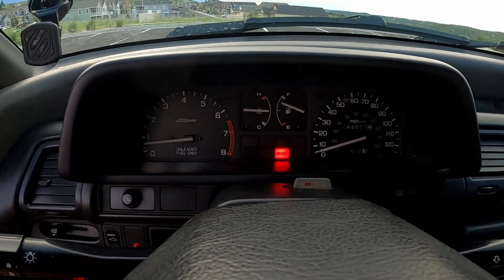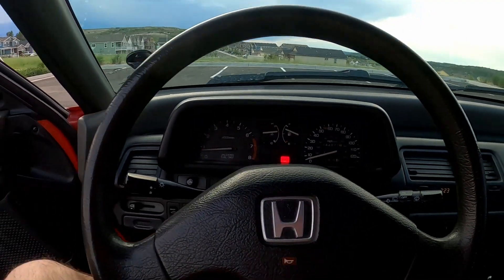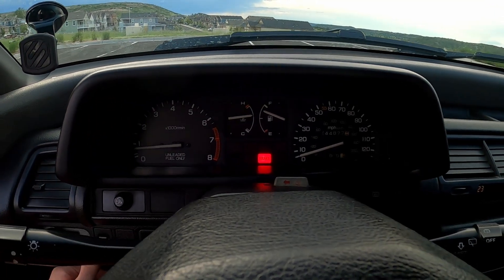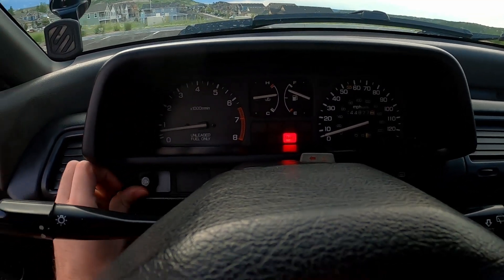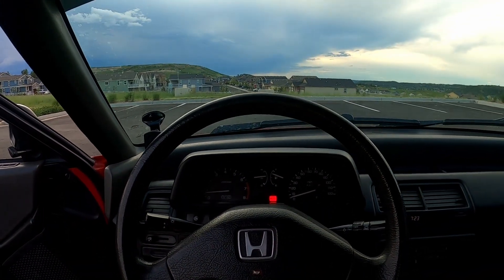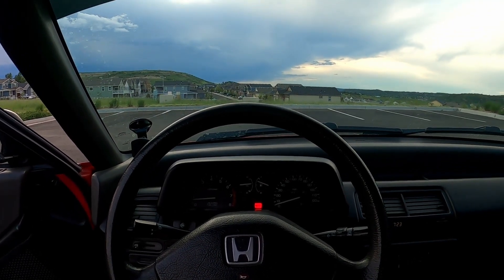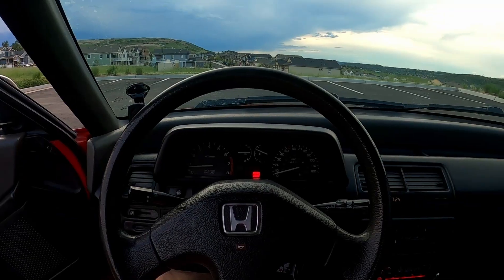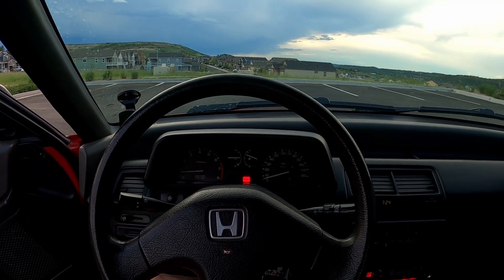Maybe it's my wiring. Very, very interesting. Feels like the fan just turned on again — it's turning on really high. I don't know what's up with that. If I click it, it goes up. I guess my fix didn't do it. I ordered a thermostat but not sure if that's really going to do it either. If anyone has any advice, please let me know. I have no way of seeing what the ECU thinks the coolant temperature is in any easy way.